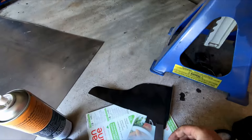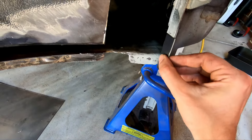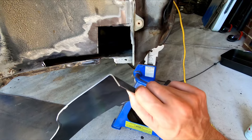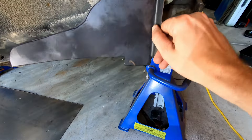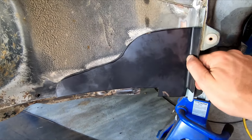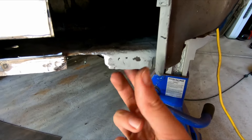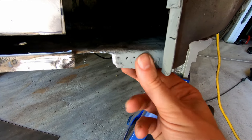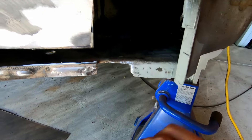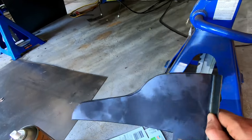There's going to be a bit of this going on this episode because this is two weeks later - I've had to go to work and do stuff. I have made up a small piece that will fit in there and fill in that gap. I've bent the angle at work in the hydraulic press and bent it somewhat to shape. I'll clear all that back and weld all around it. Underneath here I'm going to make another plate with another lip to strengthen this up, as there is a little bit of rust there that's been treated. Then I'll have a crack at welding this in.